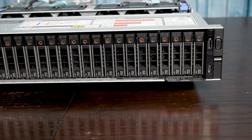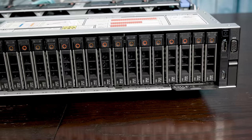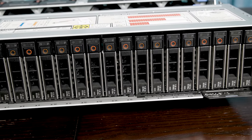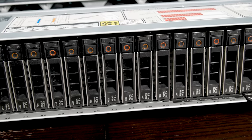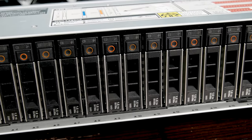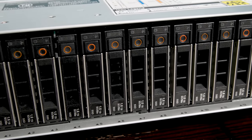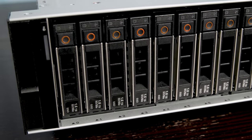Starting at the front of the chassis, you can see a lot of very familiar features from a Dell 2U server. This particular unit is a 24 NVMe SSD server, so there are 24 2.5-inch bays, and each one of those can connect to a PCIe Gen 4 x4 link — so there are no PCIe expanders in this chassis. This is the 24-bay configuration, which is the higher-end configuration. Dell also has options for 8 bays, 16 bays, and the full 24 bays, and you can have SAS and SATA as well as NVMe.